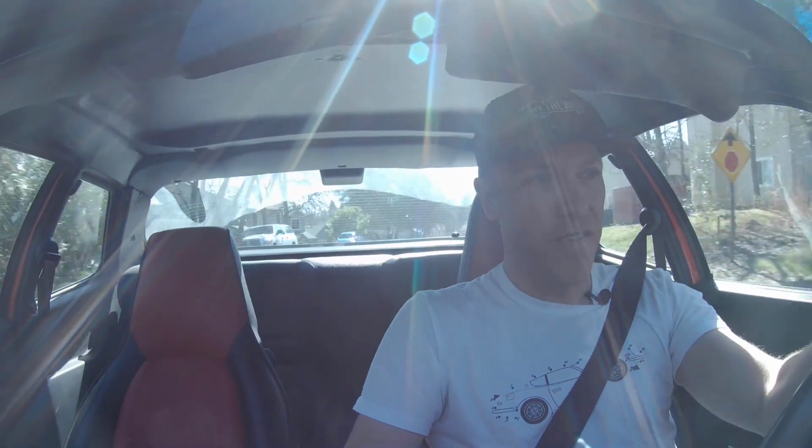So what we're doing is we're driving this around. There is a little bit of a hum I'm hearing from the wheel bearings possibly, so we'll want to check that out. There are a couple things that this has issues with. The fan only blows on high. The hood and the rear hatch slam shut, so the struts need to be replaced. And just a few odds and ends to really make this 944 go well. So stay tuned. But other than that, this car is fun to drive.